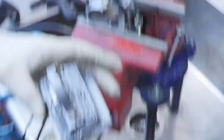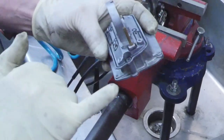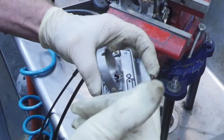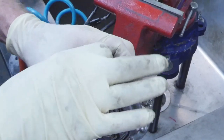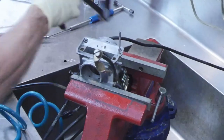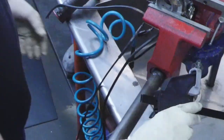Some of these carburetors have little tiny O-rings — some don't have these but some do. Put dielectric grease on them and set them in these little tiny holes. They sit on there and you want them to stay, so put some dielectric grease to hold them there — they can't move when you assemble. See how they're just lined up on the centers right there? We've done the new O-rings on our base part — you have the square ones and the O-ring. I've got a little dielectric on it and it's just sitting right in this little slot. Now we're going to put this thing together — you get one shot to put these together smoothly. I like to use a tool to hold it once I get it together.